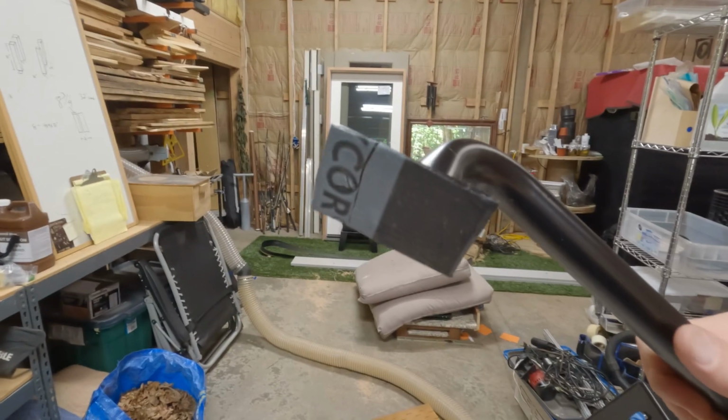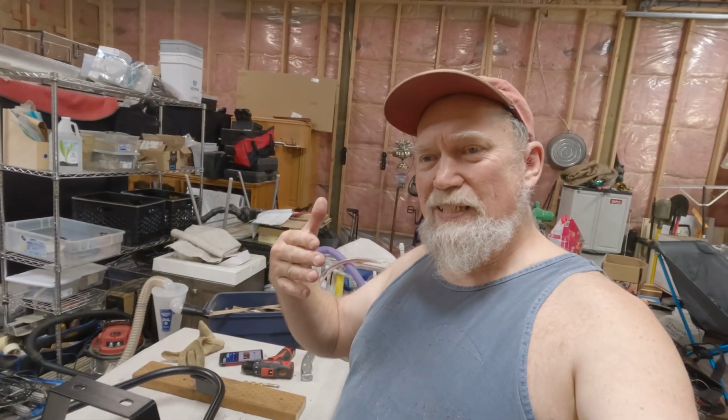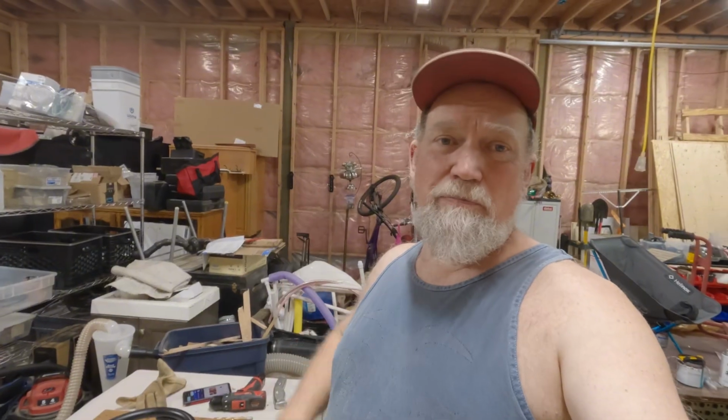covered, and I also did the backs of the bracket to help give them a little less rub on the metal to wear off the finish and cause rust. And you know, just cause. I'm going to use some smaller pieces around the bolts. I'm going to add some extra strips because they aren't sitting flat against the surface of the van. So I'm kind of worried about water infiltration there. So I'm going to put 2 or 3 strips on just around the bolt to beef that up and make it work. And hopefully it'll stay watertight.